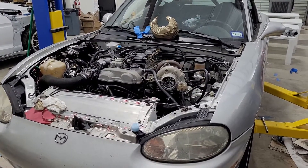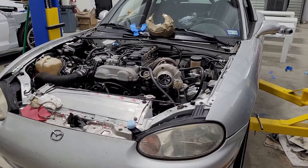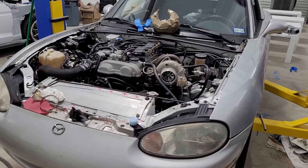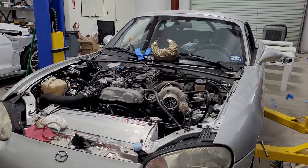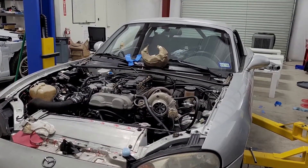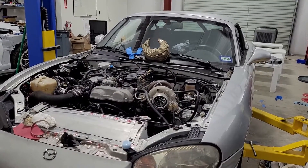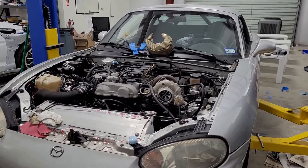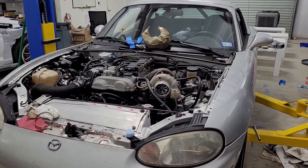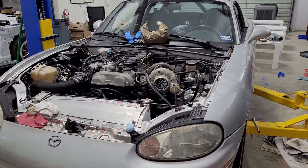The problem with that setup wasn't the front turbo — I think that was right. It was actually the back turbo that was wrong. My back turbo was just too big for a GT28 in the front. I'm not really sure what turbo would have worked best, but I'm certain I should have had the big turbo up in the engine bay, with the front turbo running there, rather than running the exhaust all the way to the back of the car.